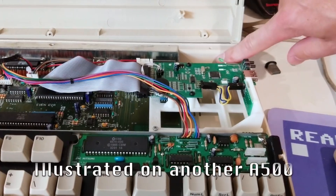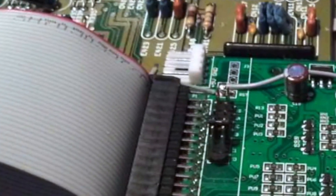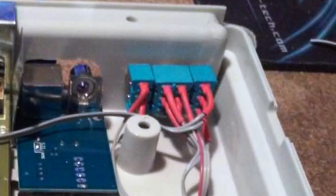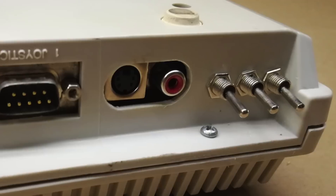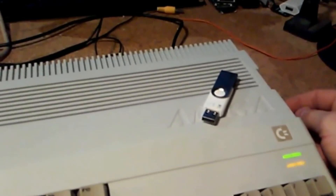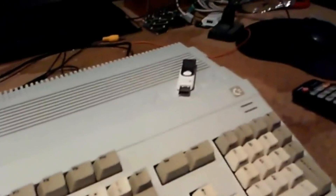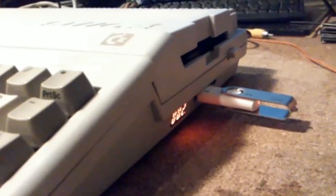So let's find a place for that switch — I think just about here should be nice. And here's the finished result: we've got our five volt wire running into that switch. And here's how it looks to the outside world. Let's just test out this switch. So that's our floppy drive working. We'll flick the switch. Stick in a USB thumb drive, and yes, it loads up beautifully.